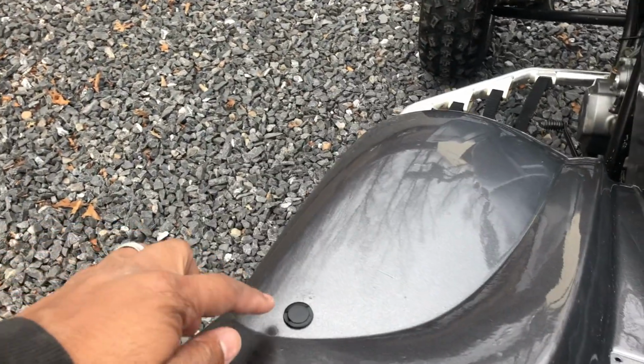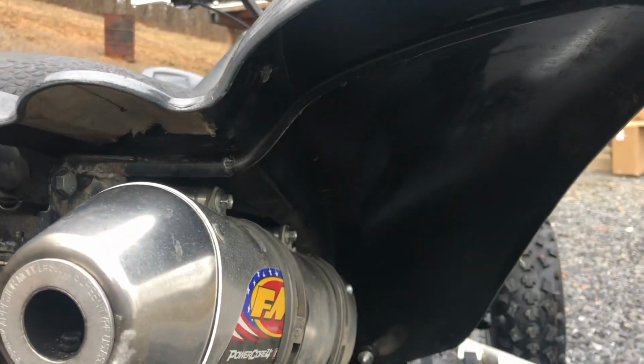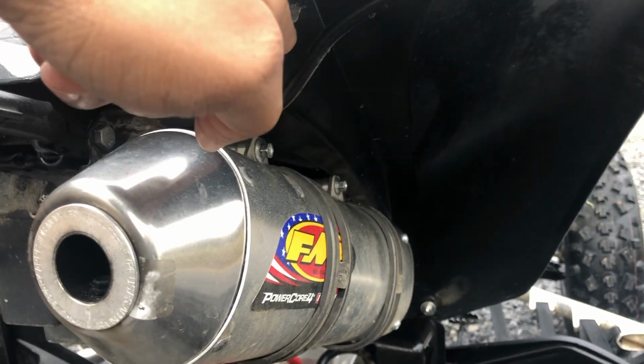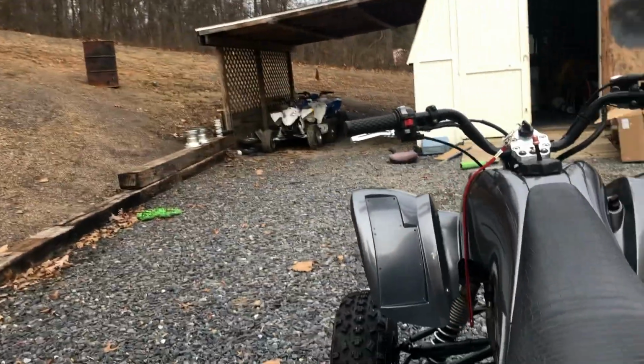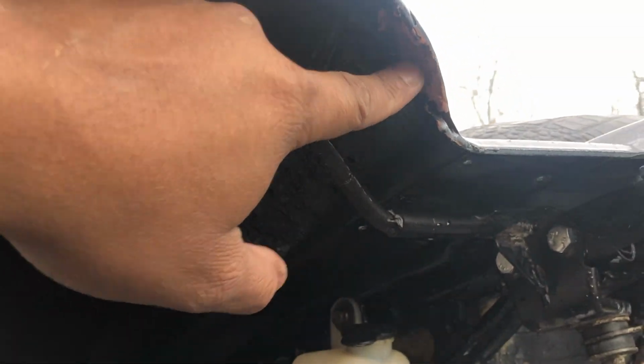And as you all notice who don't have Raptors, these little body clips here. So I welded a bracket together that comes off of here and comes across. The original mount that was here was broken on both pieces. I arched this out and put one on the outside here to keep all that flex down. It flexes a little bit, but it doesn't flop around and bat in the wind. So it's what supports this rear here. As you see, here's all the fiberglass and everything underneath. A little bit of the Bondo is still exposed, but that's fine.